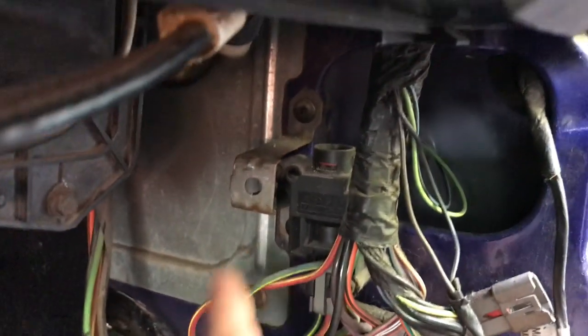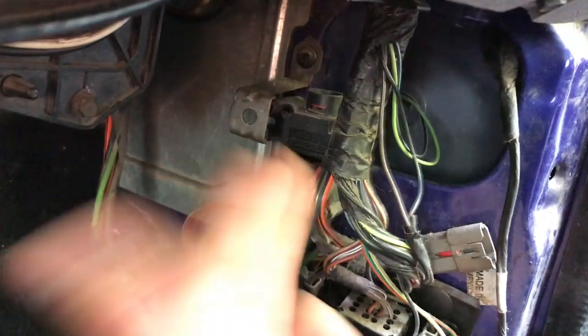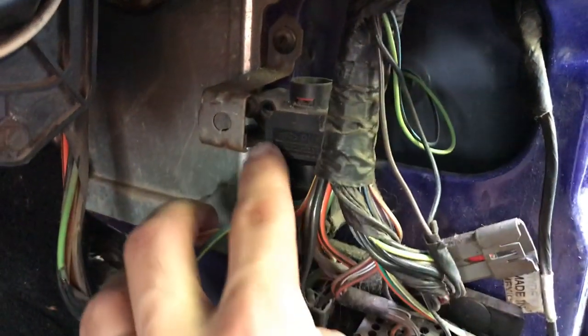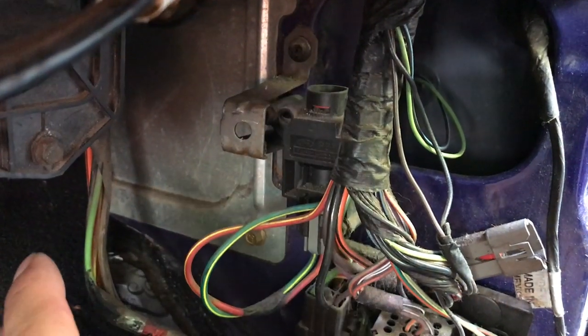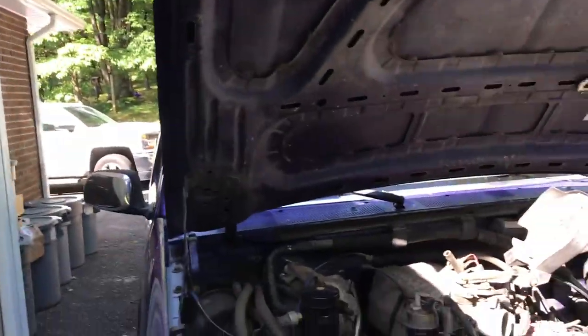The fuel system is still connected. When you disconnect your battery, the other thing you should do if you're going to mess with the fuel system is run the system dry. The way the manual says to do it: go to the passenger side kick panel and find the collision impact sensor — the thing that kills your fuel system in an accident to prevent fire. There's a red button in there; pry up on it and it disconnects the fuel system. Then turn the engine over a few times and your fuel system is bled. Alternatively, you can do the quick and dirty and just pull the fuel lines — there'll be a little spray, but honestly there's gonna be fuel coming out no matter what.